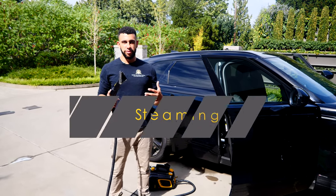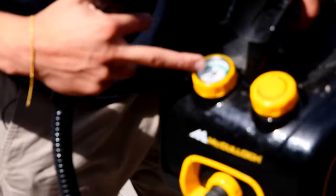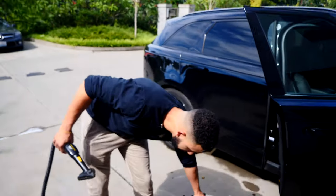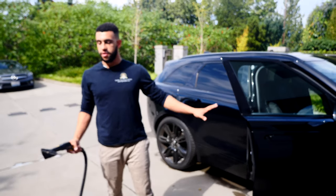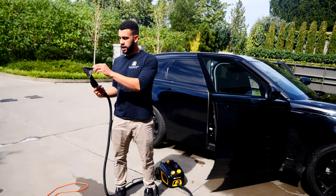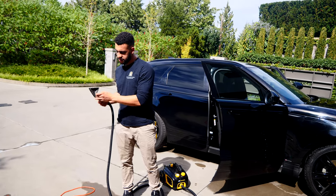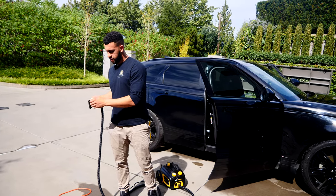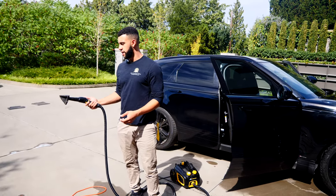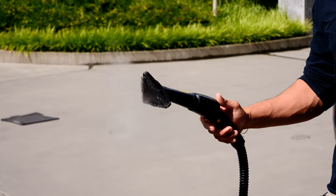Now that your steamer is hot, you'll be able to start steaming the vehicle. You'll see here that the steamer's needle is in the green — it's getting closer to the yellow area but it's not at the very bottom anymore. One thing you'll want to do before you start on the vehicle is let out the air bubbles and get it going well. I like to clean off the nozzle before I start steaming — make sure there's nothing too big in there from the last job. Once you get all the big stuff out, give it a good little wipe down and let the steam and the air bubbles out. Now it's going good, so I can go ahead and get started.